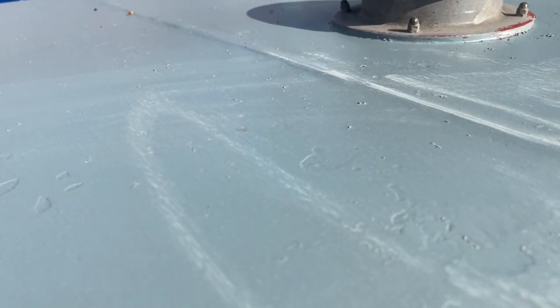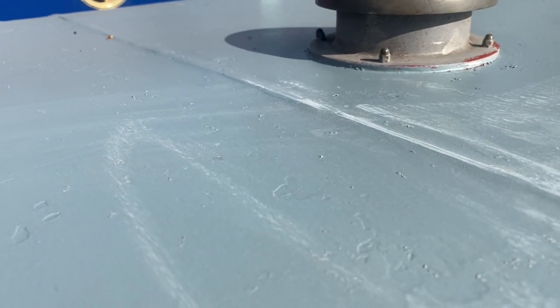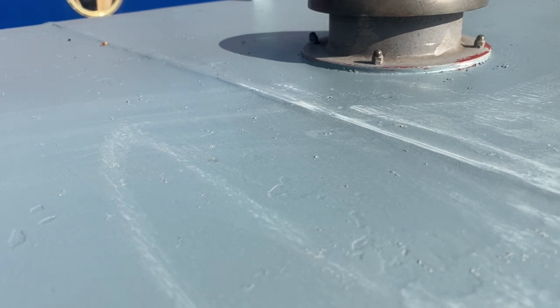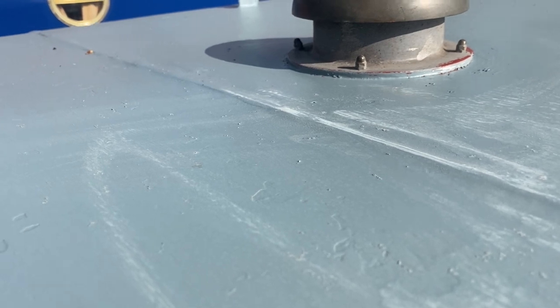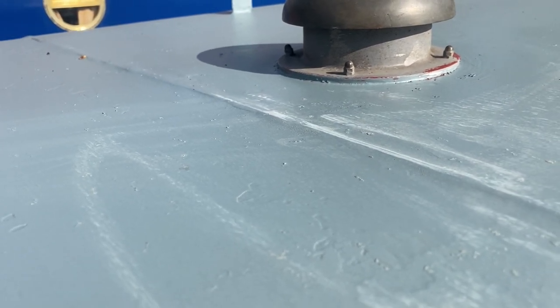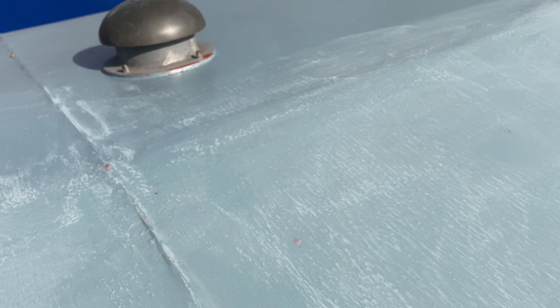This is the surface. You'll see there's just little bits which I need to take off now, because if I don't it's just going to exaggerate it as more and more coats of paint go on. So I'm just going over with some really fine sandpaper taking off some of these little bubbles. I'm hoping that more coats of paint will improve the hollows, as opposed to those raised bits there.